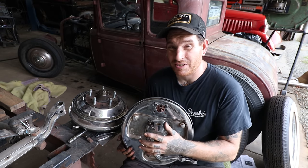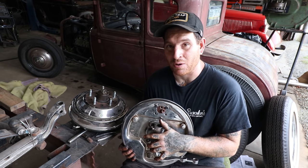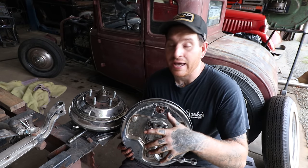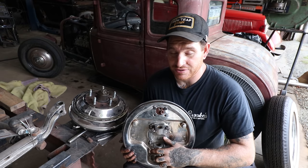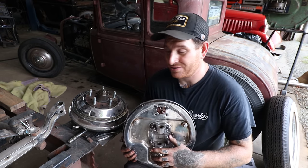Now, all of this work that I've done is basically just so I could see if these spindles that I bought, these chrome spindles, will clear on my old chrome drop axle that I have. I bought these off, I think, the Ham, and a guy said they came on a drop axle and cleared, but every drop axle is different the way that it's stretched and clearanced. It doesn't always mean it'll work with it, so it is a gamble buying some of this stuff.